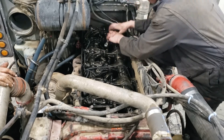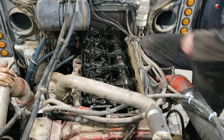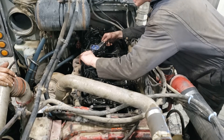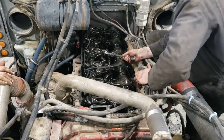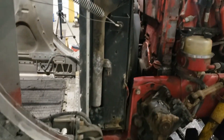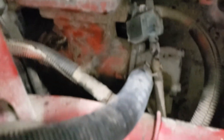If you want, roll through all the remaining cylinders and check the individual valve lash on each to make sure you didn't accidentally set exhaust to one of the intakes or vice versa — it doesn't take much time and saves headache later. Once you've done your double and triple checks, put the valve cover back on; the torque spec on the valve cover is 28 foot-pounds. That wraps it up — hopefully this helps with getting your valves and injectors set. Leave a like, subscribe for more content, and leave any questions in the comments.